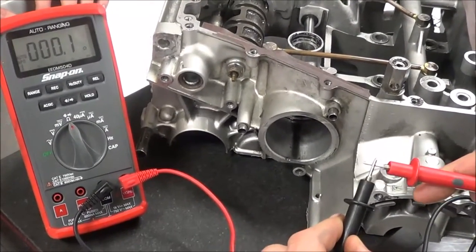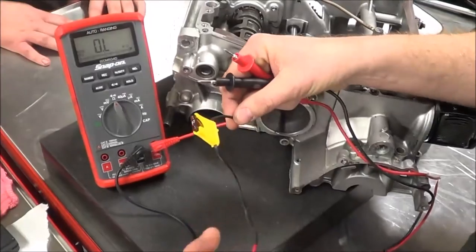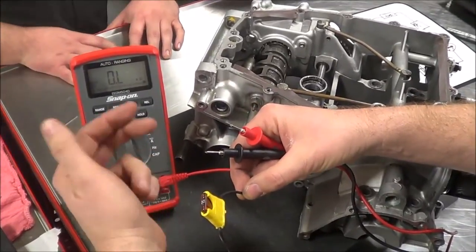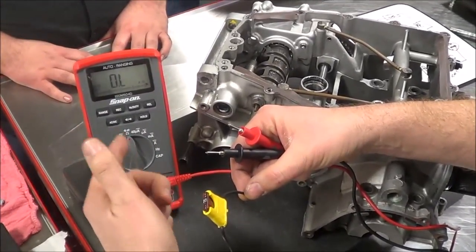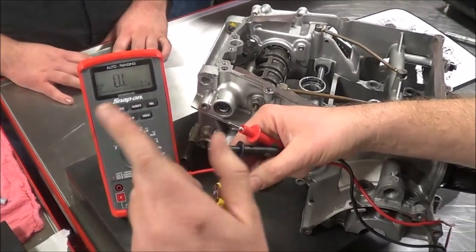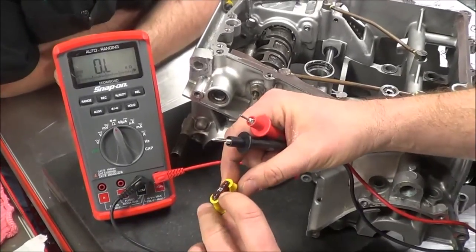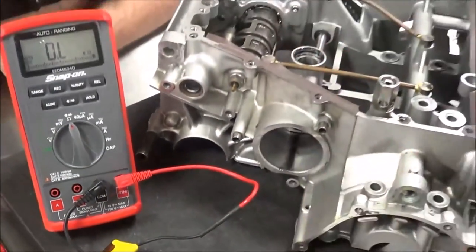It's real common to have one or two tenths of an ohm for continuity — just the length of the leads. For training purposes here, we actually wired an external fuse, because when you guys hook these up we like the fuse to blow rather than the meter. There are fuses in the meter but they take a screwdriver and popping the case off, and those fuses are like $12 or $15 each. A trick we saw online was to wire an external sacrificial fuse — it's a 7.5 amp fuse, and it really should be fused for 10 amps, but 99% of the time we can't hurt the meter or components.